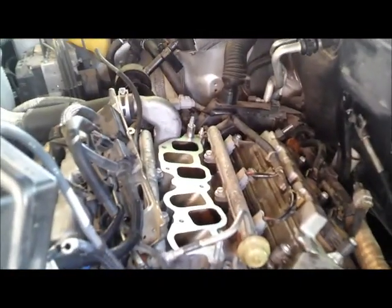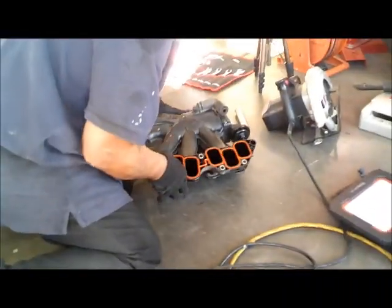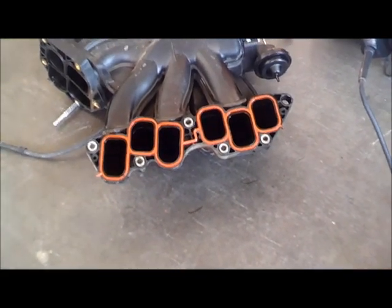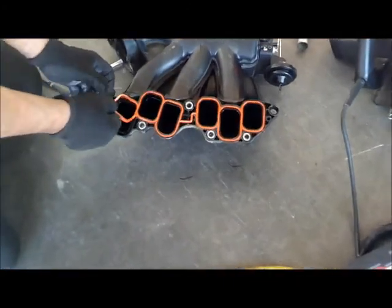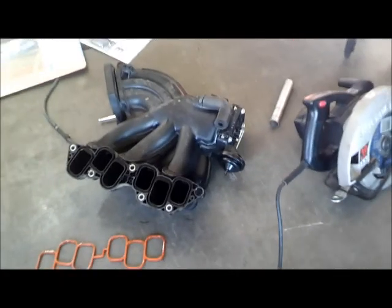Alright. Shoot, there may be something over here, huh? Like that. Can I drop that or just stay on the thing? It's on the manifold? Yeah. The bushing. Alright, let's see what we have over here. Okay, we have to replace the gasket over here. Manifold gasket. I think he bought a gasket. Alright, we'll remove this gasket and we'll replace it. We'll have to clean that. Spray clean.